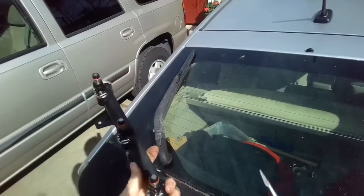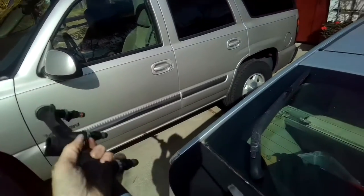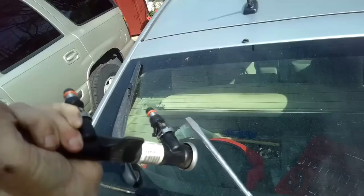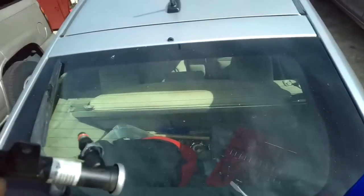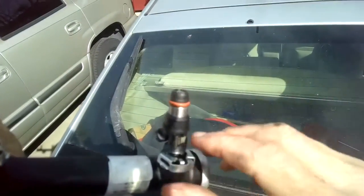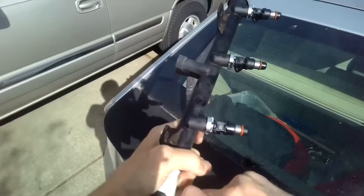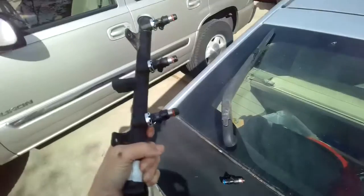I've got the fuel rail, which usually sits like this, right? I'm going to take these clips off the back, put a standard head screwdriver in there, and you could do this while the rail is still on too. Get that out. Pull that off. I'm going to pull off this injector. Put that off to the side. Pop in the new one.